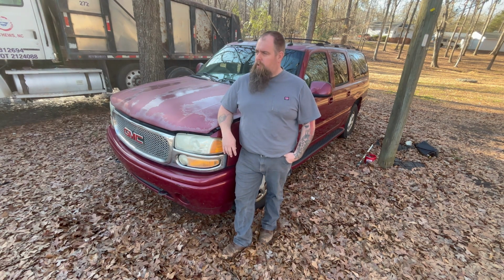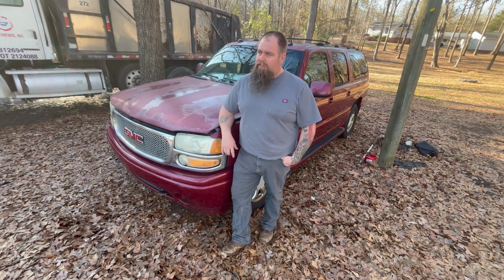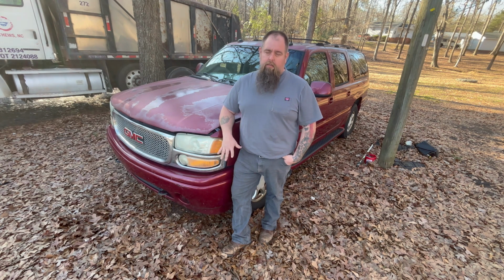Today's video we're going to be working on the tow rig. What's going on is I have a power steering leak, and on these Denalis, '04, I think it's a '07, maybe a little earlier too, I have a Hydro Boost. So basically it uses hydraulic fluid from your power steering pump to give boost for your brakes, and it's leaking out of it.